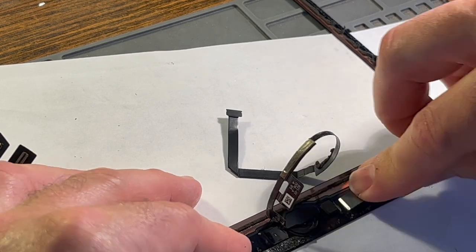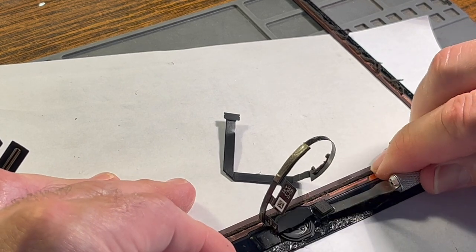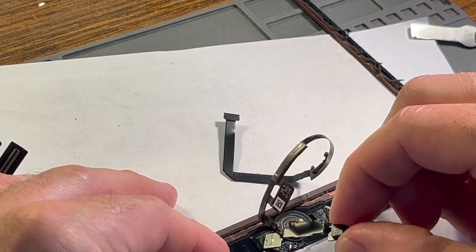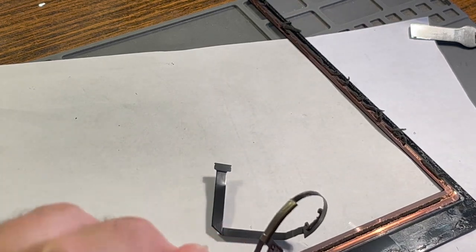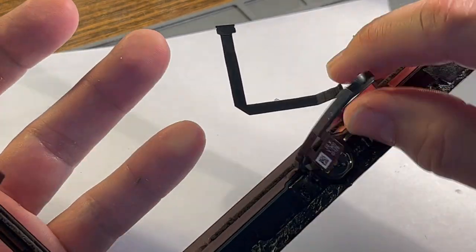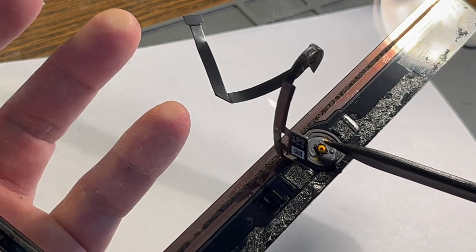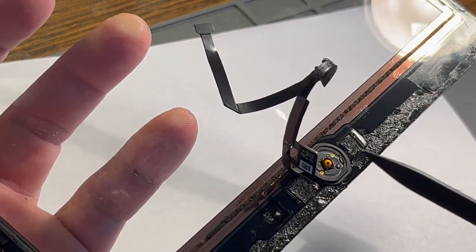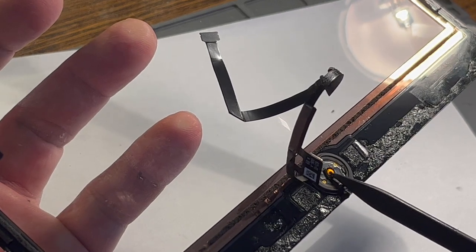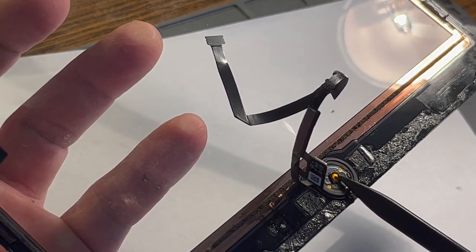Using my X-Acto spade again, I'm going to go underneath this bracket very carefully and slowly, and not on the side where the cable is — because I would risk slipping and cutting that. I'm coming to the opposite side. I get underneath that one side and pry it up. Now I'm going to lift this bracket straight up and out. The reason I do that — this is a terrible design — you can see there's a little black dot in the center. This little switch: if you push that bracket and wiggle it back and forth, it will snag on that little nipple and break it off. Removal of that bracket the way I just did it is the way to do it without damaging that little nipple.